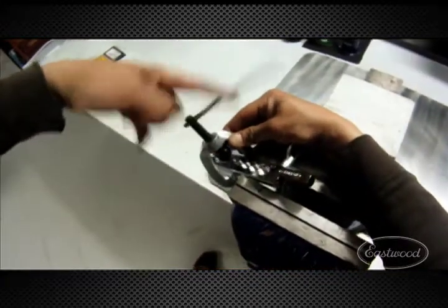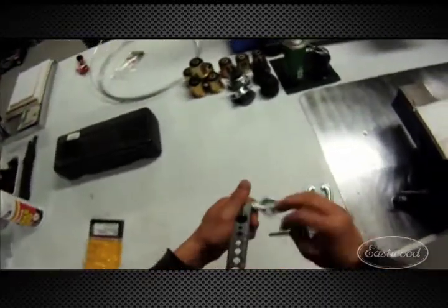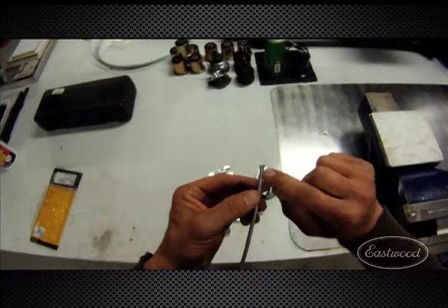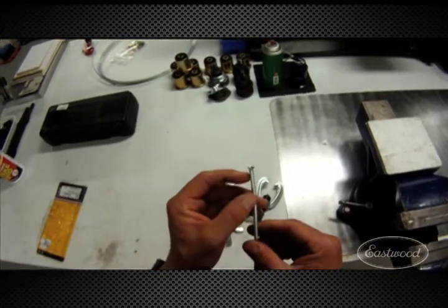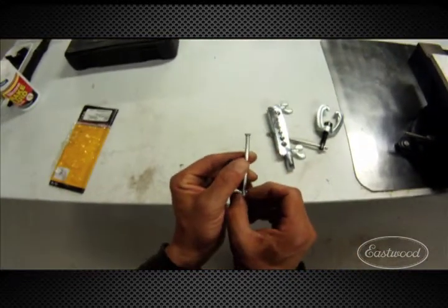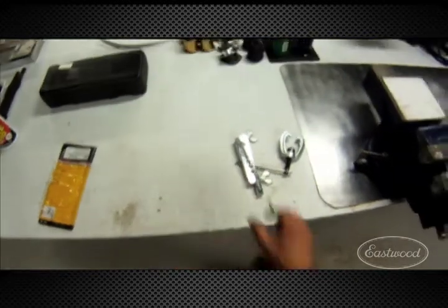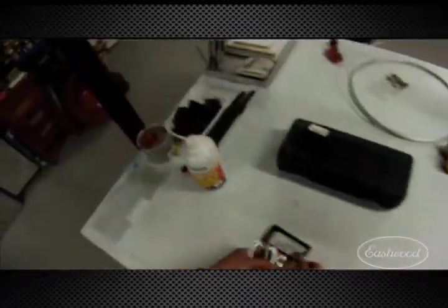Here's what you're going to get with your budget flare tool. Looking at it right now, we know that that's unacceptable, because that's not even a double flare. Look at that — I wouldn't want those stress-induced risers there at all on a brake line. Look at the cone. This isn't even good for a water filtration thing under your sink. Maybe what we can do is save this and make some lead sinkers or something like that. But that's that.